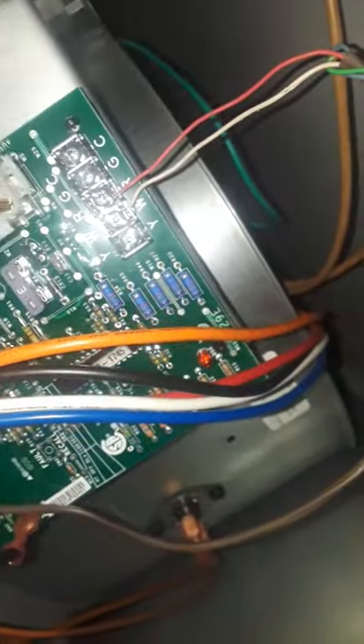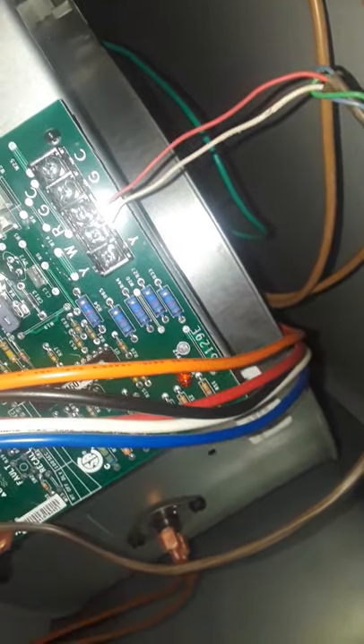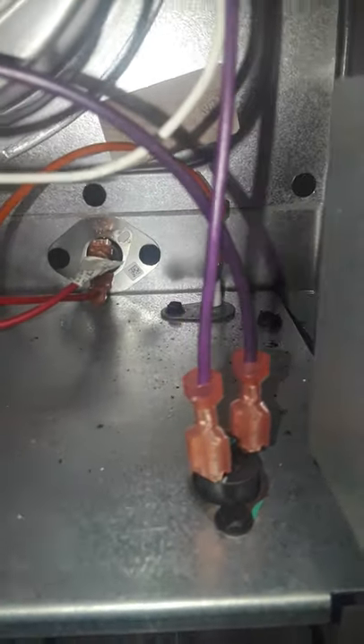The flashes were coming from this LED located on the motherboard — it would flash six times. The open rollout fuse is here, and as you can see it's got a button on the top. All you do is push it down; it doesn't have much movement. You push it down and it basically resets the fuse, and that's what my problem was.